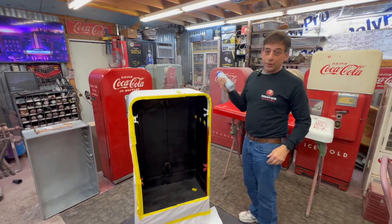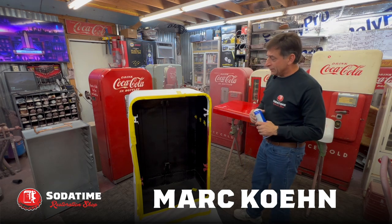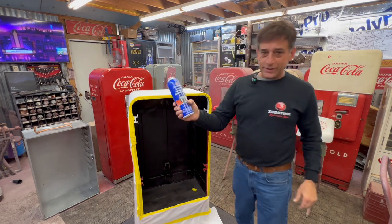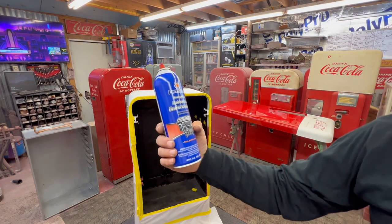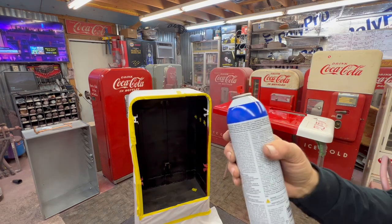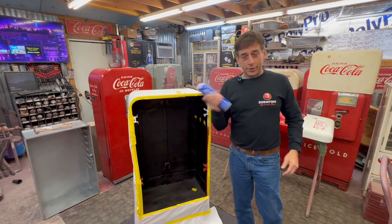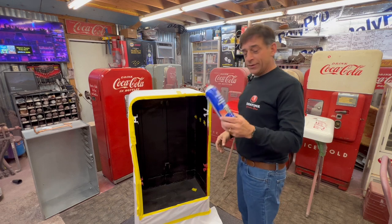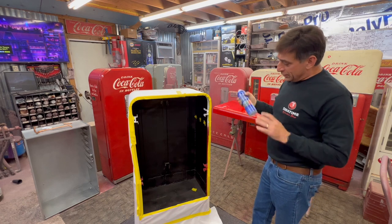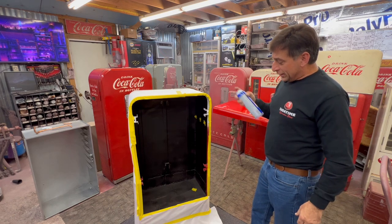The 56 is looking really good. The cabinet is just about done — we've buffed the outside and everything is looking good there. We're getting ready to do the coating on the inside. We're using a product from Permatex, a heavy rubberized undercoating. Part number is 765-2644. You can get that at your NAPA Auto Parts store. If you don't have one, look for the Permatex brand undercoating. I like the rubberized — I think it's just a little better coating. We've got one coat on there now and we're going to give it one more before we put it down and get ready to put some insulation in.